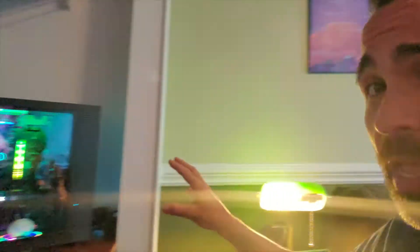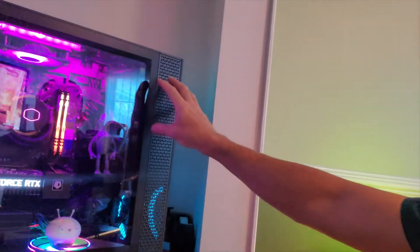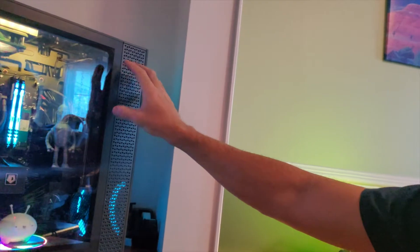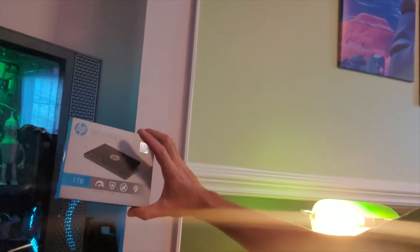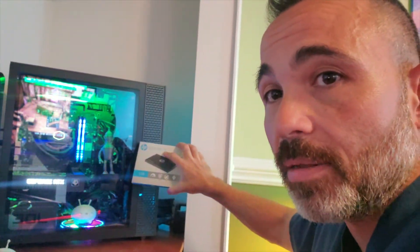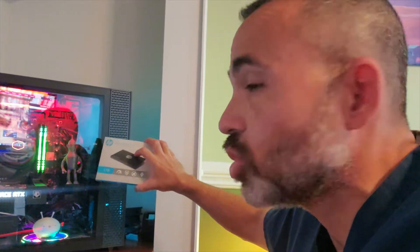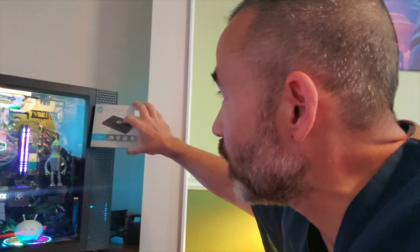The easiest way we're going to do this: I'm going to shut the whole system down. With the 30L, I know we have another spot that we could fit a hard drive in, but I want to eliminate the mechanical drive altogether. So basically, I'm going to shut the system down, install the SSD drive on the bottom SATA — the power and the data — turn everything back on, use the software to clone the drive, then shut everything back down, switch the hard drive to this one, and turn everything back on. Hopefully everything works out good.